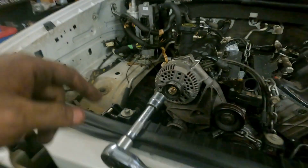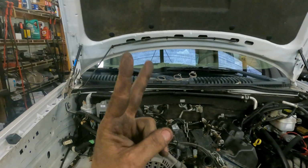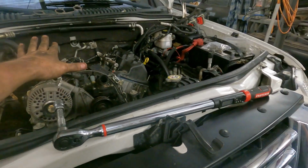We've got the motor mount bolt on this side in. This side has studs that stick through the mounts, so let's double check those since I haven't reached down there yet. All right, yep, they're both stuck through the mount, but there's no bolt, no nuts on them. They just, 2 studs stick up just like that, and then it sits on it. That's nice. 2 transmission bolts are bolted up, torque converter's lined up, and it's just sitting here in its home now.